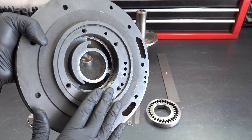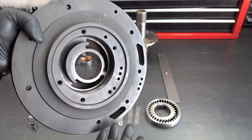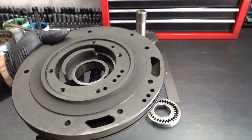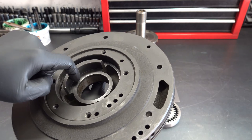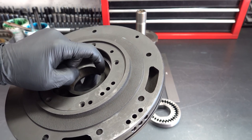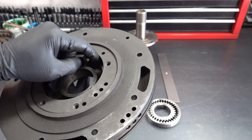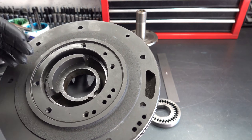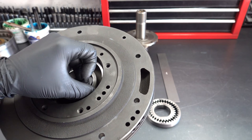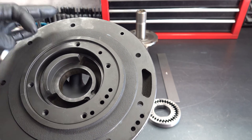You want to make sure that all your working surfaces are in good shape and serviceable — no obvious scoring or other kinds of damage. The areas you really want to pay attention to are going to be the floor itself. Just take your fingernail and drag it across. You should not have your fingernail getting caught up on anything, no scoring so deep that it's stopping your fingernail from moving. I don't feel anything like that with this pump.